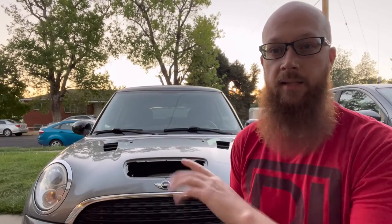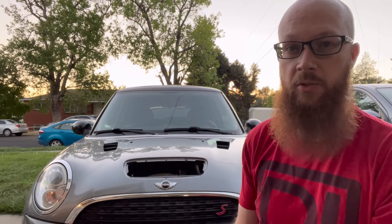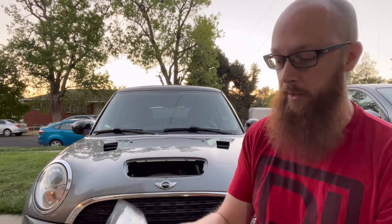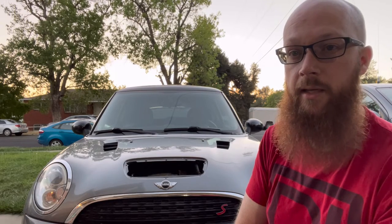It's a new day with it being light outside so you can actually see what I've got going on. I do have a little bit of a fitment issue — where it used to sit along that rubber seal at the very top, it doesn't sit there anymore and is just sitting on the actual hinges. I picked up some washers to use as shims to move that hood height up just slightly. On the corners they do poke out slightly, so I'm just going to tweak those in on both sides. I'll do a bunch of cleanup everywhere we cut because we don't want to leave any sharp edges, and then we'll be good to put the vents in and the scoop in.